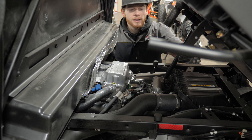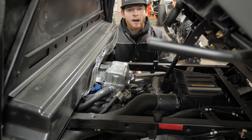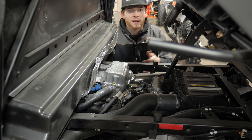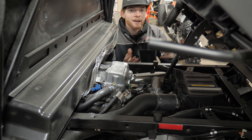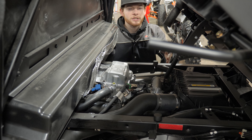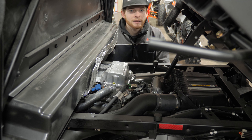Your air filter and air box is right here. There are just two clips on the front and the lid will pull up and back. Keep a Polaris stock air filter in it — these really are the best for maintenance. The Polaris air filters do not allow too much dirt into the engine. Aftermarket race filters do allow more air through, but in the conditions these ride in, that also means a lot more dirt. I'll see vehicles come in with the front side of the piston worn completely off because of dirt sucked through from an aftermarket air filter. Change the air filter every time you change the engine oil, and in really dusty conditions you might have to change it every weekend.